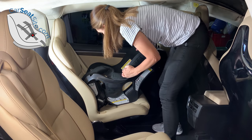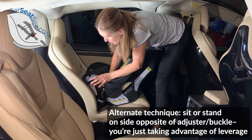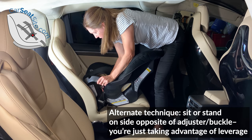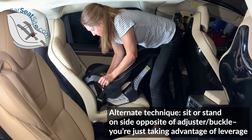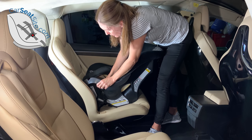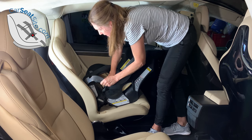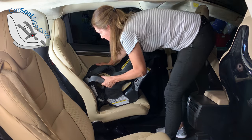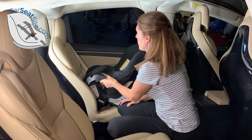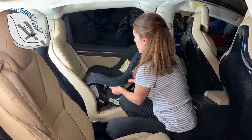Another trick I'm going to show you is to get up and go behind the seat if I can. If I can't, that's no big deal. But another trick is to get in and put some pressure right here above this adjuster, then push down and pull. So I'm using my weight here and putting some pressure right here, because in doing so that's pulling all of that slack out of that latch belt going through the belt path. If it ends up tipping a lot, no problem — just push it back into position and you'll notice it's nice and tight. It's shaking the car, it's so tight. Then just push that back down, put the cover back on and you're done.